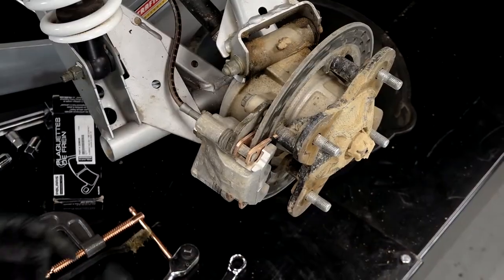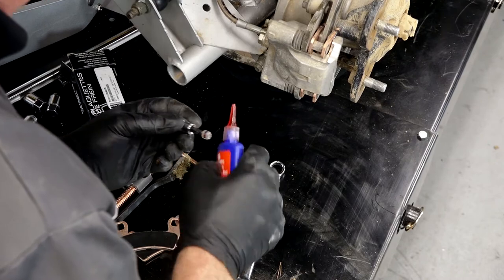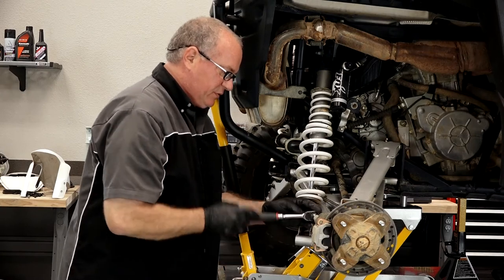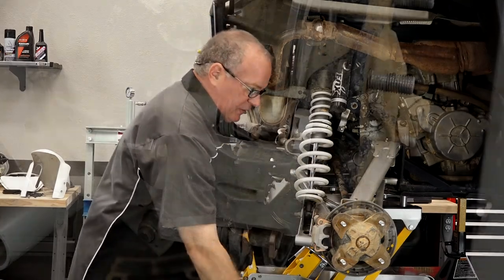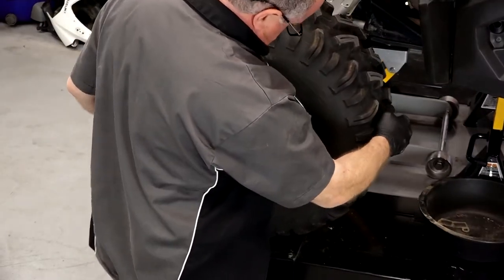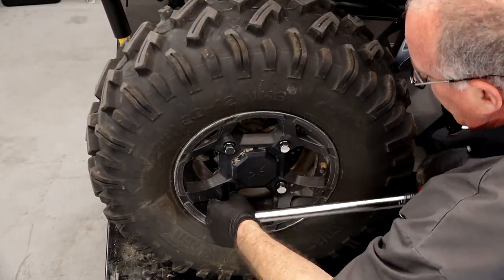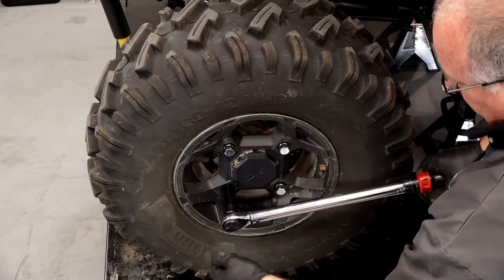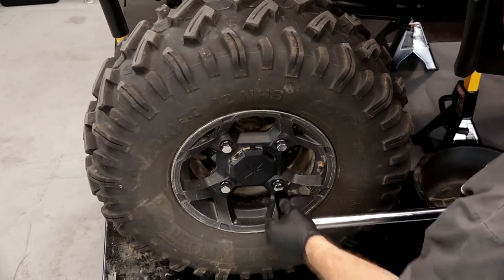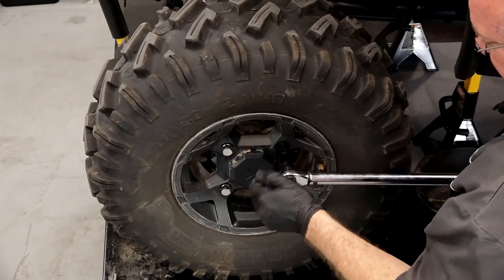Next, I want to take that pad adjustment screw, pull it out, put a little bit of Loctite on there, then bottom it out — don't put a lot of pressure on it — and back it up just a half a turn. At this point we just need to pump up the brakes and we'll be finished with this side. Let's get the tire back on and get it torqued back down. I've got it in park, and I'm sure the transmission can probably hold it, but I don't want to put that much stress on it because we have to put 120 foot-pounds on aluminum rims. If you've got steel rims, they only need 60, but these are going to need 120. So I've got somebody up in the driver's seat holding the brakes — that'll take the stress off the transmission. And there it is.